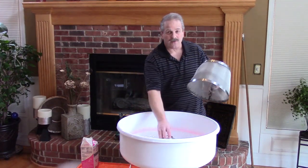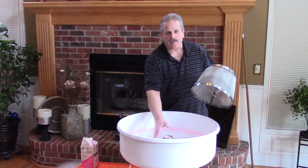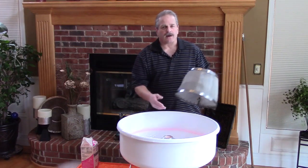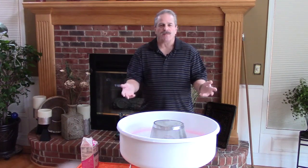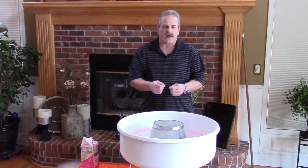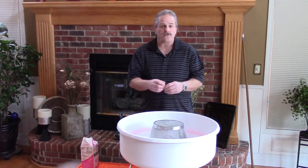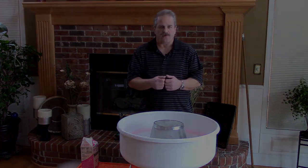You can always tell if it's cooled down enough by checking the floss head. It's still warm right now, but it's not so burning hot that the floss is going to start to smolder and smoke or caramelize real hard. So those are your options for making single cones, doing pit stops, multiple cones, and then if you're going to do an actual shutdown for any period of time, kill the power to the coils and the heat source, then let it run for a while to cool down before killing the power to the engine.